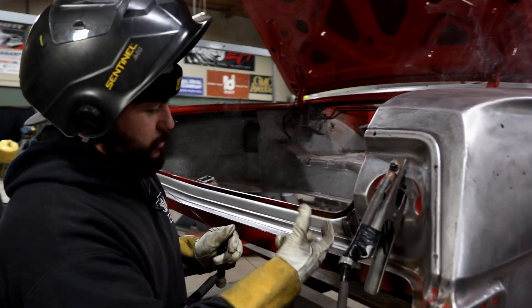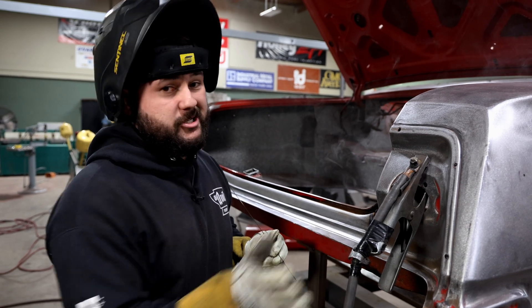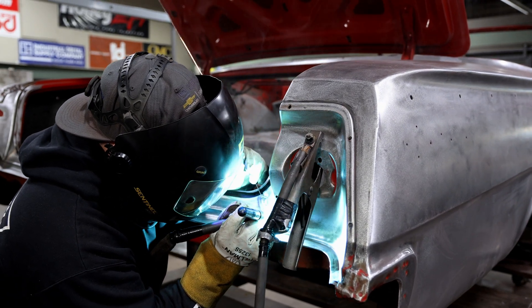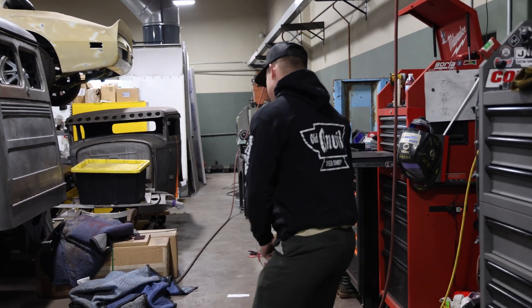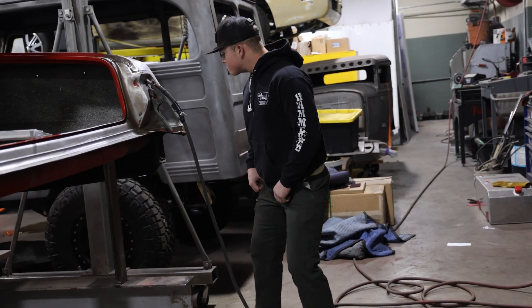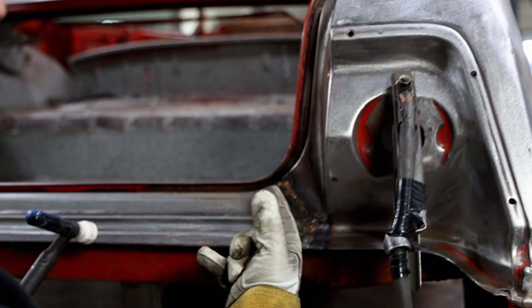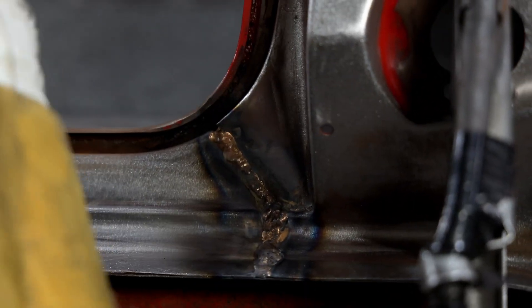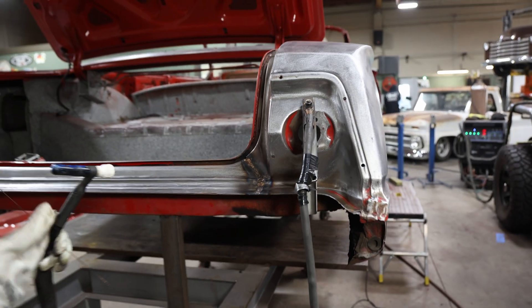And you can see too, down in here, when they put these factory seams together there's a lot of seam sealer and things in there. So we go ahead beforehand and we try to burn most of that out, but sometimes there's a little bit left over. I'm just kind of burning through it and we'll grind everything back out. Seam sealer and all that stuff, it's all coming to the surface as you're burning into it. So like I said, we got most of that out of there, but anything that's left over on the inside of that flange, it's all going to burn out with the heat and come to the surface. So I usually just keep burning it out, get it all out of there and then I'll do a grind on it. And if I'm low in any areas, I'll go back and refill and then grind it again. That's all you can do really in a seam like that where it's dirty.